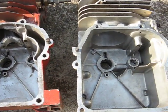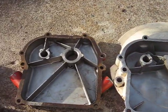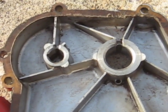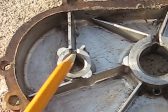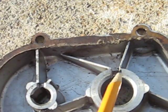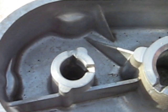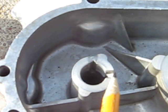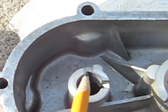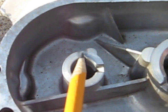So that's the main oiling changes in the block. Now, the crankcase cover is a little different matter. Here's the regular rototiller one — it has a feed slot at the top, one on the side, no drain, and a feed slot for the crankshaft. Now, the lawnmower's feed slot is on the side, so it would be best to plug that one with JB weld and hacksaw or cut one in the top. You need it to feed from the top.